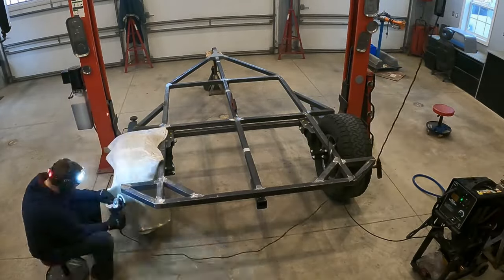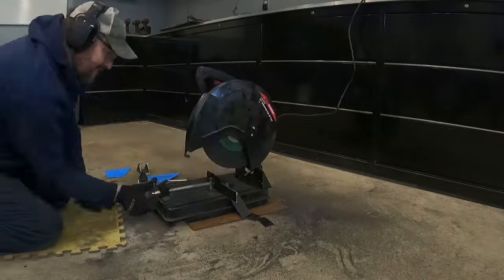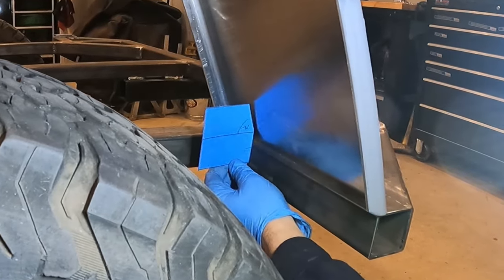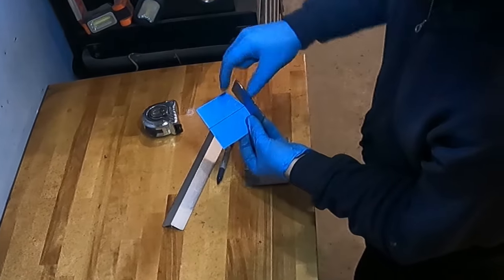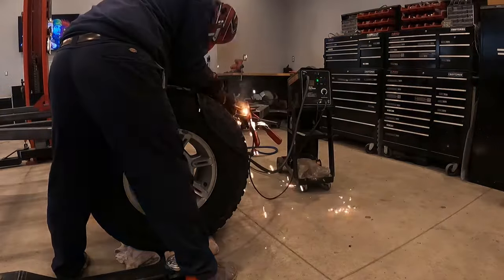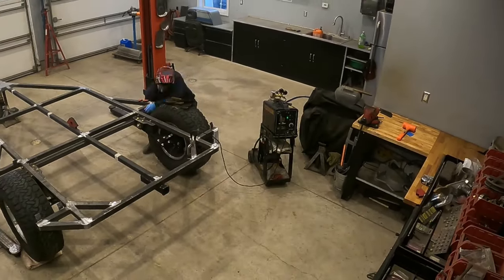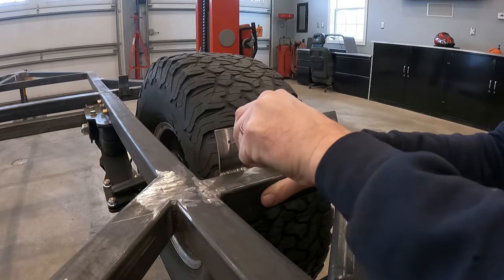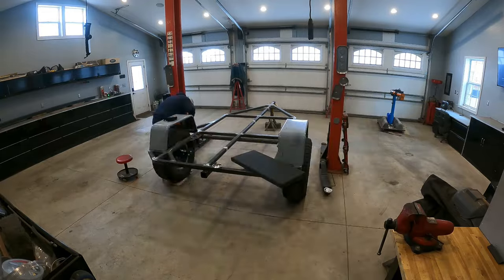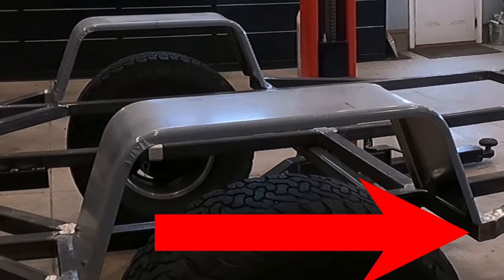Now it's just a matter of welding the rock sliders from the outriggers back to the frame, then setting the fenders back in place to figure out how to mount them. For this, I decided on using metal tabs welded straight to the outriggers. The metal tabs have to be bent, and to find the correct angle, I used a piece of blue tag board and marked it. I transferred these marks onto the tabs and put them in the vise to bend them at the correct angle. Once I was happy with the location of the tabs, I welded them in place. The same process was repeated on the front outrigger, then four more tabs were cut, bent, and welded into place on the passenger side. To mount the fenders to these tabs, I drilled holes through the tabs, used those holes as marking locations for the fenders, and drilled matching holes. Each fender uses four grade-8 bolts to secure it. I also capped off the end of the outriggers to make sure no moisture gets in.